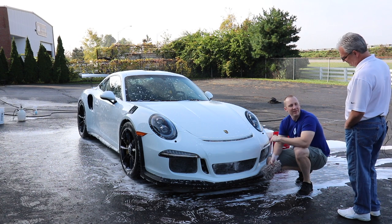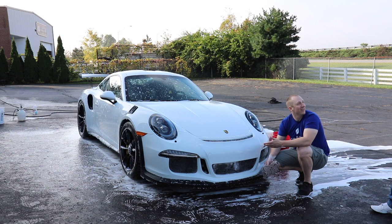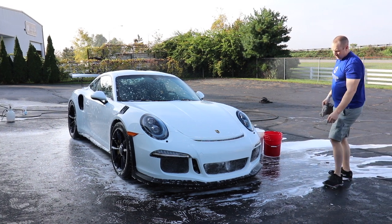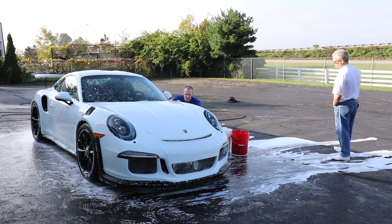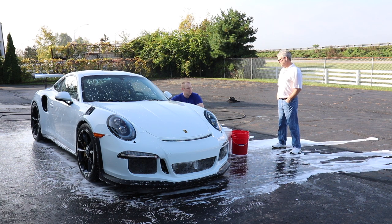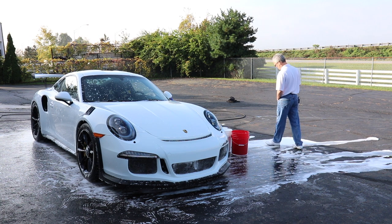Normally if we weren't going to polish this out, I'd leave a bug like that till the end, rinse the car off, come back and hit it with my drying aid. But right now there's dirt on the paint, so normally I'd want to agitate it so when we spray it off it comes clean. Another good way when you have some left over at the end is take a little tar remover and put a little bit on there to loosen it up. Generally if you have a good last-step coating on the vehicle it should come off a lot easier - even 155 mile per hour track bugs come off much easier when you've got it coated or have quality film on there.